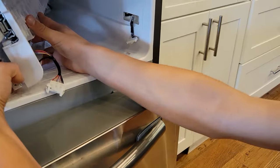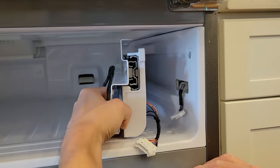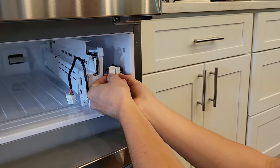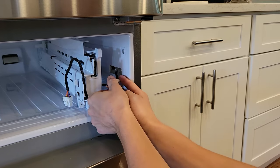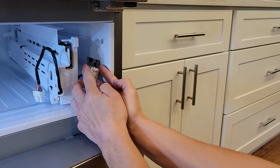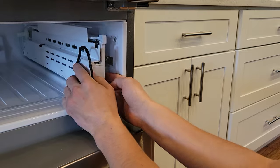Right back here there's a little hook that goes into a groove in the back of the fridge, so you kind of just have to come in at an angle and then it slides over. We'll get this cable connected — take care when you're removing this not to break any of these clips. I think I broke one on the old harness as I was taking it off; not a huge deal but you just don't want to break all of them. And that clips in just like that — we'll tuck it away so that it doesn't get pinched.